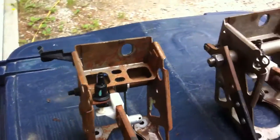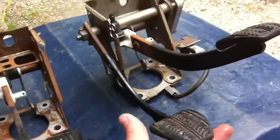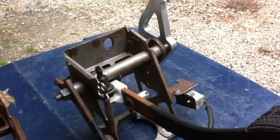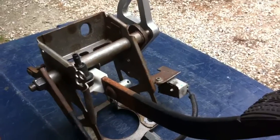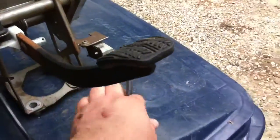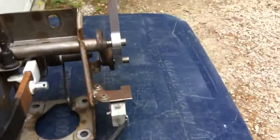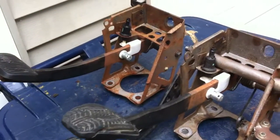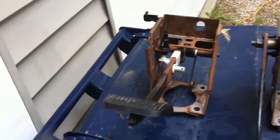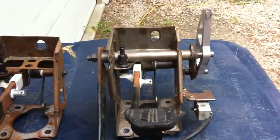So anyway they're not too different. They look very similar other than the addition of the clutch stuff, and this setup should bolt right up. I've got to clean up the engine bay a little bit more and get a new brake booster. Then this can go back in and I can wire up the clutch cable and everything. I'm not sure what I'm going to do with this connector since I don't have a plug for it right now, so I'll have to figure that out. I thought you guys might like to see the difference between the two pedal assemblies — this is the original one out of the automatic car, and this is the one going in from a five-speed car.